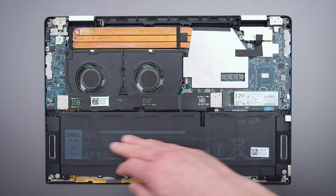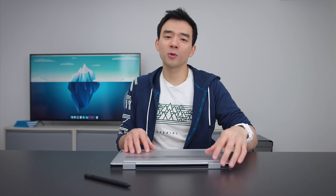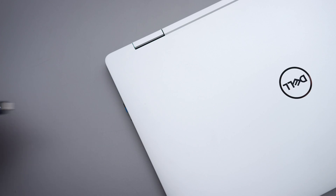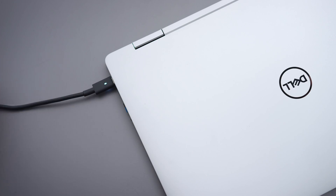Battery life is not what I expected. It's actually a pretty big battery at 75 watt-hours, but battery life was short. I'm not sure if it's a software or driver thing that can be improved, but right now I'm getting around five hours at 250 nits on a 75 watt-hour battery. On a device like this I would have expected seven, maybe eight hours — I'm getting five.